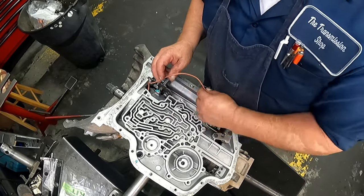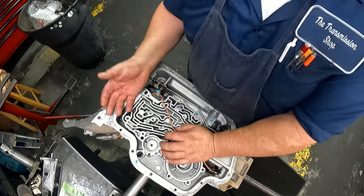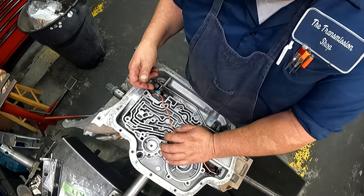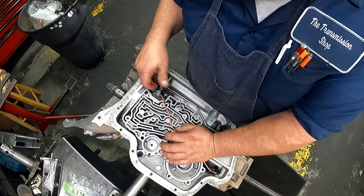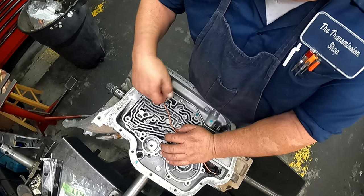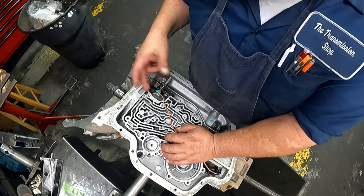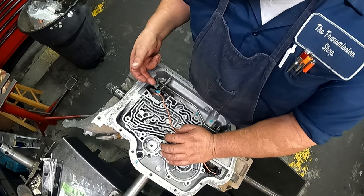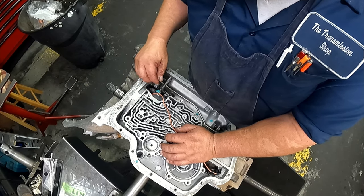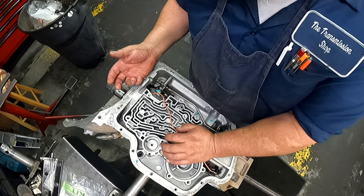Oh, one thing I did forget to put in there. When you're tearing one of these down, there's a little nail that goes through here and it holds this linkage and keeps it from moving back and forth. If you bend that over, it won't fall out. If you do forget to put it in, you can bend one and stick it in there. Just bend it over. You just need something to keep this from moving back and forth. You can use a nail.